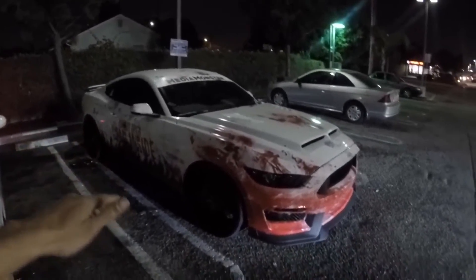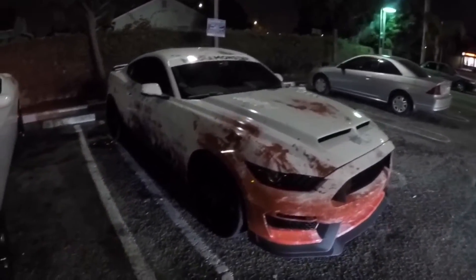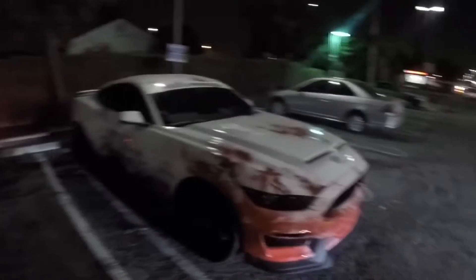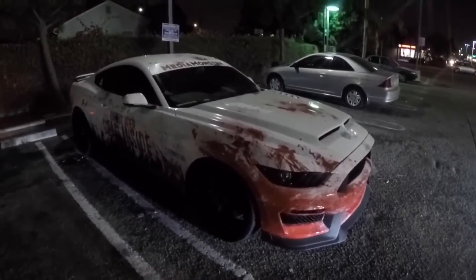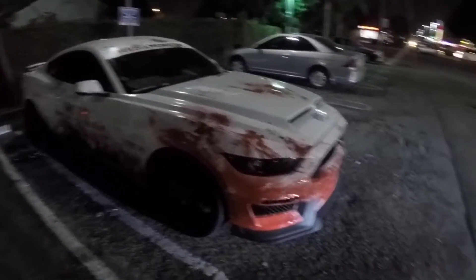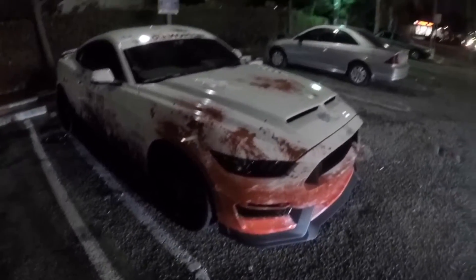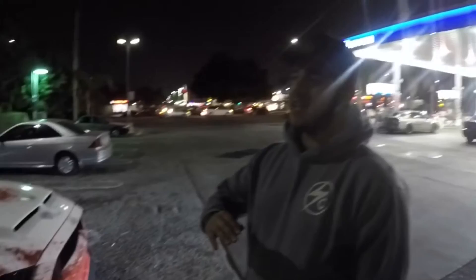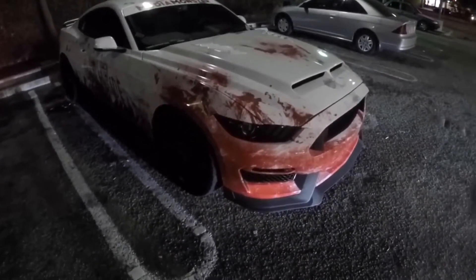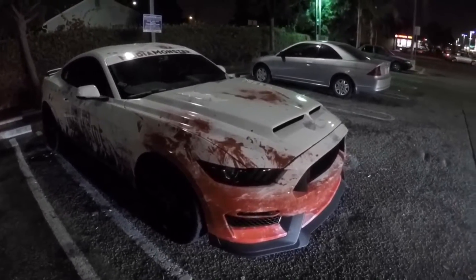The race is done and it seems like the Mustang has a little bit of an advantage. You gotta give credit to it — it was definitely fast. It's more on the top end though. He's running 3.31 gears, so it takes a bit to build up. With 3.55s or 3.73s it would pick up a lot quicker, so he's more of a high-end car than anything.